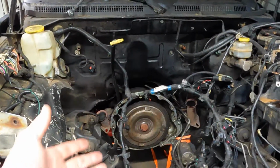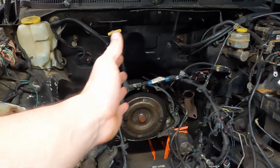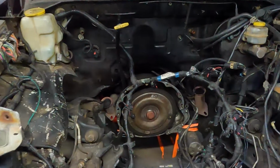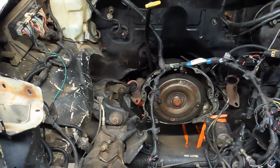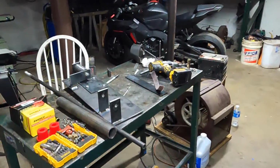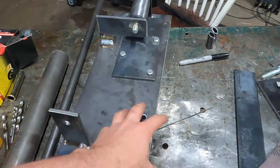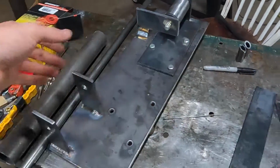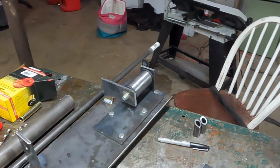That's great, except it's supposed to be an inch offset, so I couldn't bolt everything back up. I had to move everything over. And then the headers were hitting things that they wouldn't have had I just put it back where it was supposed to be, or just moved it straight back 1 inch. But that's why I didn't want to try to measure and do this. I just used the motor mount that came out of it, put it back where it was. It's going to line up, everything's going to be fine.